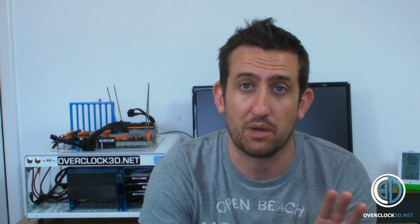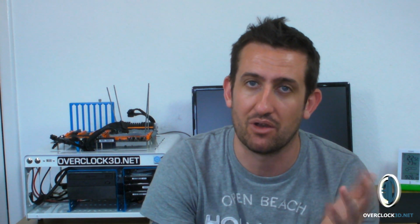Now when I got this board sent to me in the first place, I'd been overclocking for a long time. I know my way around an X58 BIOS. I mean, 4 GHz is easy to get to. My highest overclock to date before getting this board on air was 5.2 GHz, just for a CPU-Z screenshot on my 990. Now during testing, I got my 980X to 5.945 GHz, and that's where it decided to die.